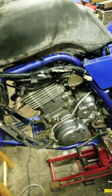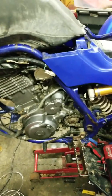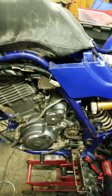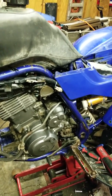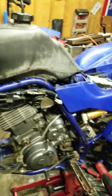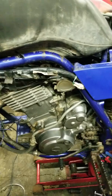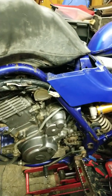I did go ahead and set the intake valves and the exhaust valves. Then I went through the carb — the guy had a china carb on it. Right now it's got 155 on the left, 160 on the right. I did three turns out on the left on the idle air adjustment, and two turns on the right.